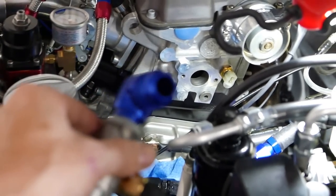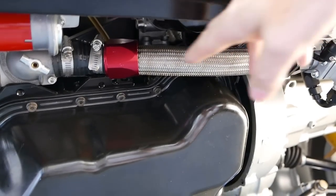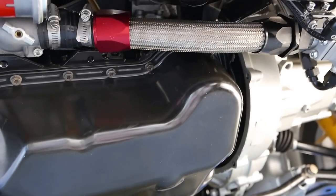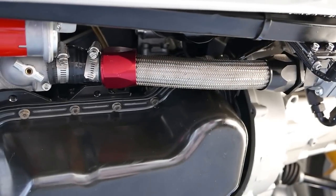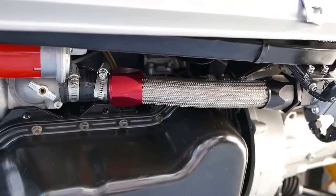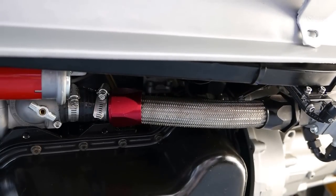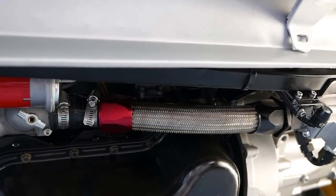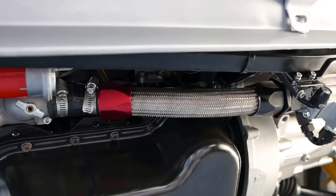Just cleaning up the O-ring surface and putting it back in. By removing the temperature sensor underneath, I had this adapter that the temperature sensor had put in place, so I've installed a longer AN20 line to the old water pump housing that has the impeller removed. This whole thing works really well now — engine temperature, I set it at 190 and it held absolutely at 190 at the cylinder head, which is perfect. If I want maximum power I could set that at 160 or 170, and for better engine wear and mileage, set it at 190.